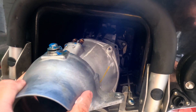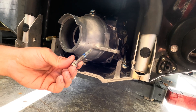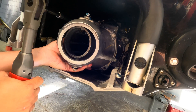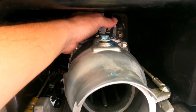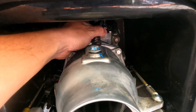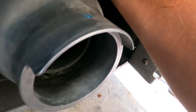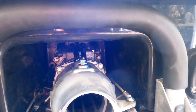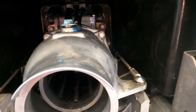Now we're putting our exit nozzle back in place with a little bit of blue Loctite on each bolt. After you tighten your exit nozzle, you're going to reinstall your bilge pump Venturi lines — those don't have a hose clamp or a zip tie, they just go on like that. Now we're going to reattach our steering linkage; that is a 10mm bolt and we're going to apply a little bit of Loctite.